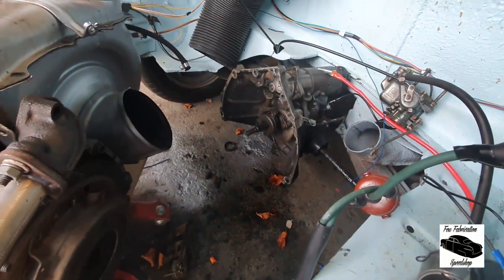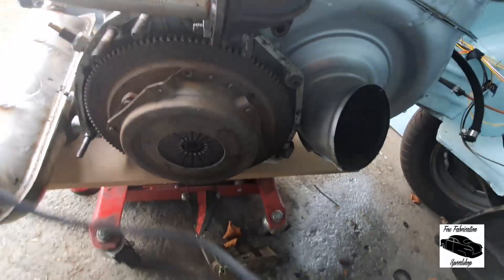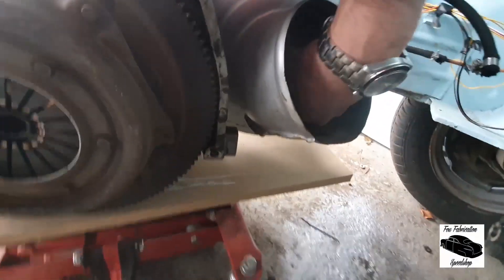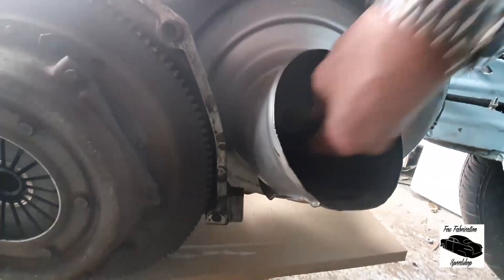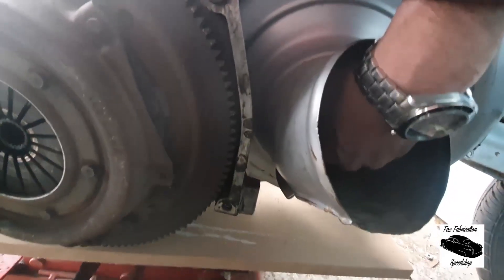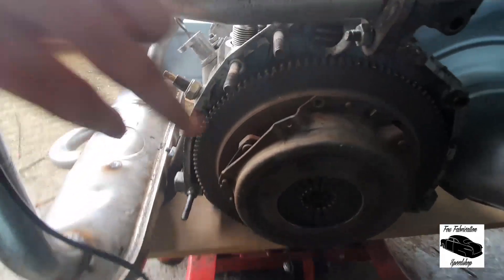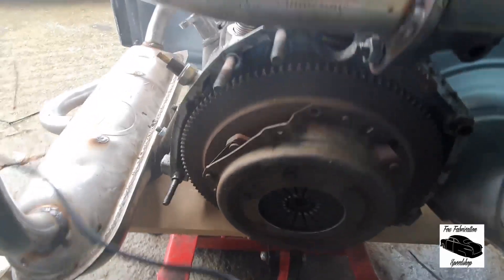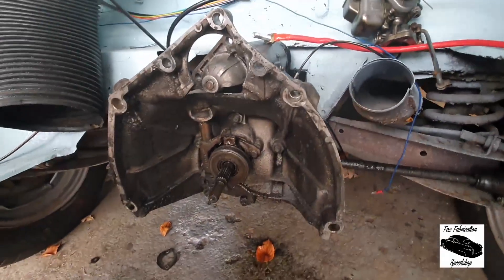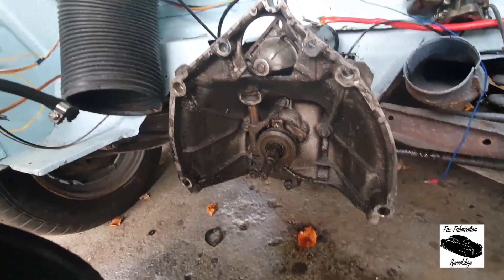All off, nothing damaged, nothing banged into. Straight away we can identify one of our big banging noises — the cooling fan is exceptionally loose. The clutch plate seems to have sheared a bolt on the pressure plate, which is probably not helping engagement. We'll pull it off anyway and change the bushings and the clutch release fork as well, since it's here and easy to do.